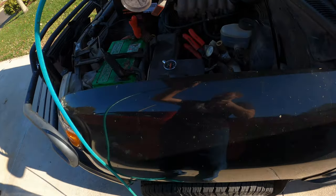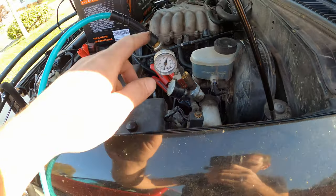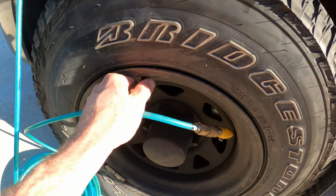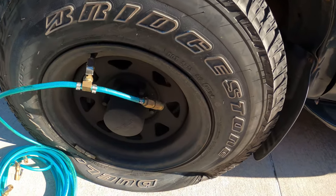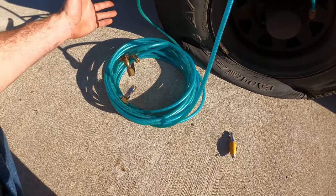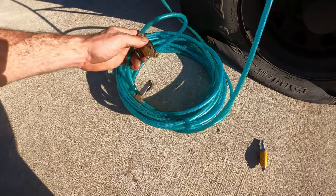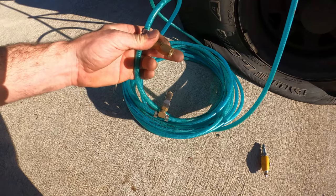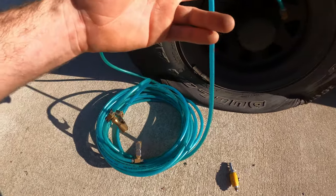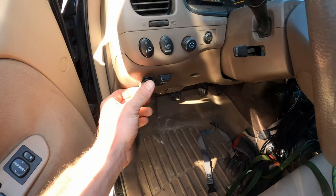The ARB doesn't come with a hose, but I made a custom hose — I'll plug a link to that video. It fills all four tires at the same time, which works pretty awesome: hook it up, open the ball valve, check the gauge, and these clip-in style valves go on each tire. This really saves time when pumping up all four tires after off-road use. If you build one of these, make sure you get the sealed clip-on valves — there are two different kinds.